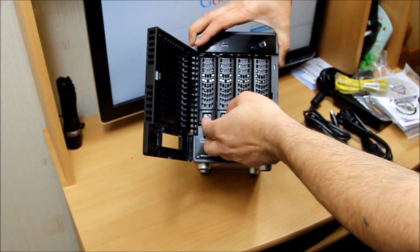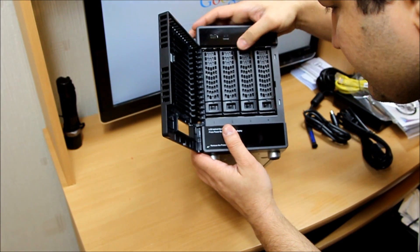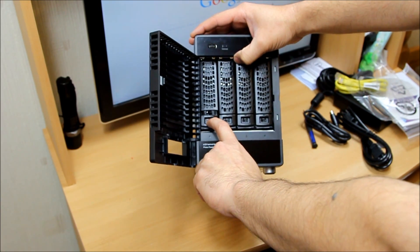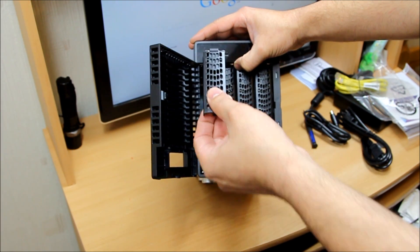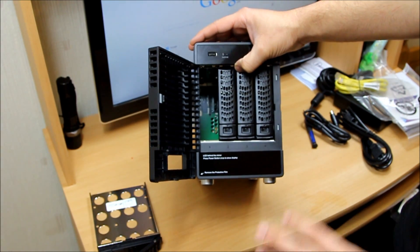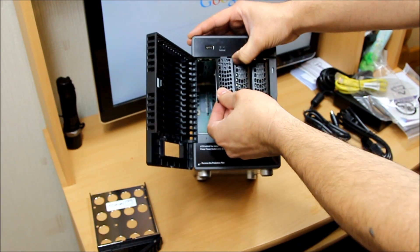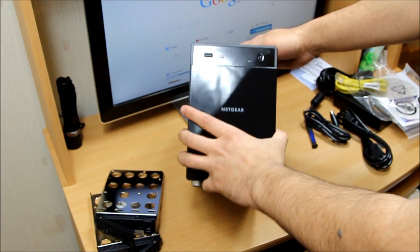So how do you open the drive bays? Right there in the middle there's a button. You push it that way and the tray comes out — you can simply slide it out. That's how you insert a hard drive into the carrier. I've not read the manual; you just put your finger in, push the button, and slide it out. Very easy.